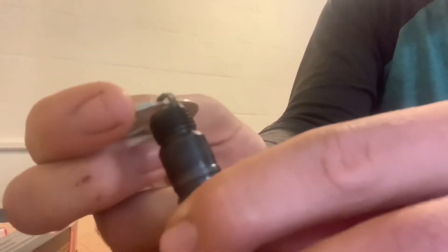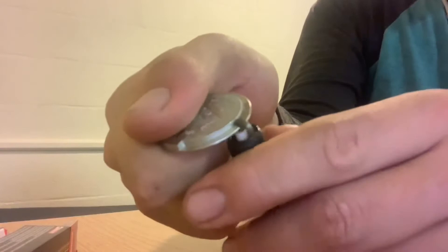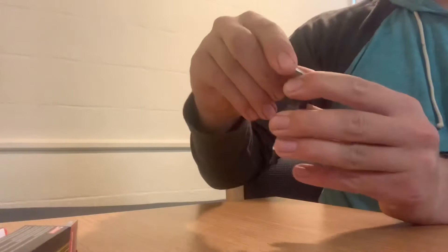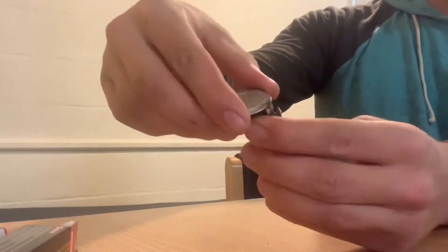You're gonna work it around to the applicable gap height as detailed by your manufacturer, which in my case is 0.054 inches. And once you do that, you guys will effectively get your spark plug gap set correctly.